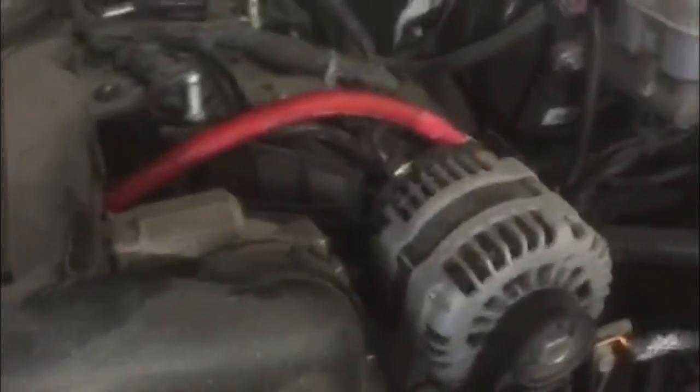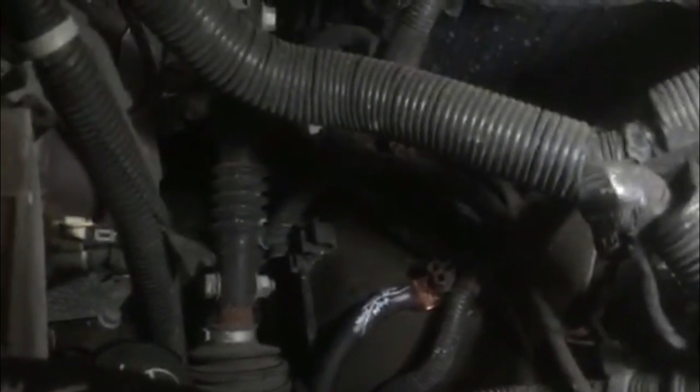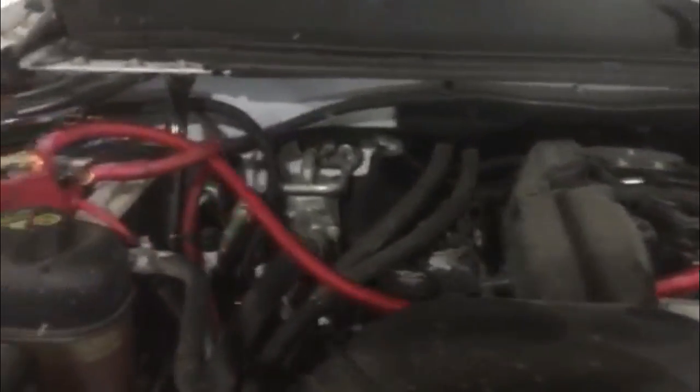Got all the upgraded Sky High wire going from the alternator for the big three. We got the run going to the back — power wire going to the alternator. I got another ground going to the block right there. We got the other ground going down to a bolt on the frame. So that's the big three: two main grounds, main power run — switched it all out from CCA to OFC.